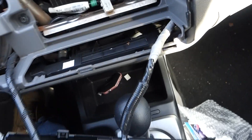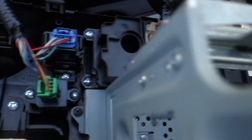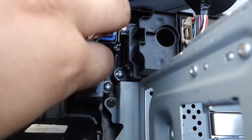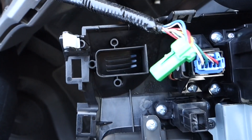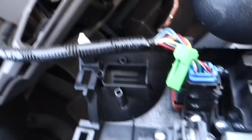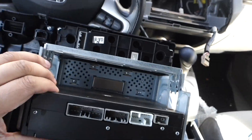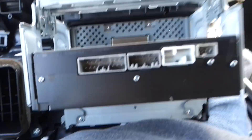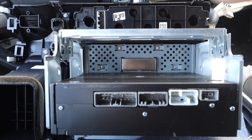Like any radio installation, you have your wires back there — these harnesses you're gonna have to pull out. It's very easy, just a little pull tab at the top. Press that down for your first set of plugs. Then there are these ones as well — same method, little tab on the side, press that down and pull up. Keep pressure off those harnesses from being pulled, just make sure you're holding this at a good angle. Here's your radio and the connections at the back.